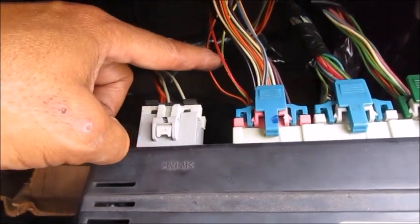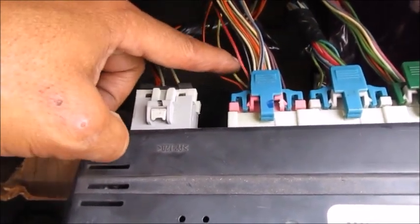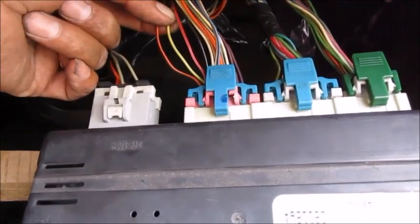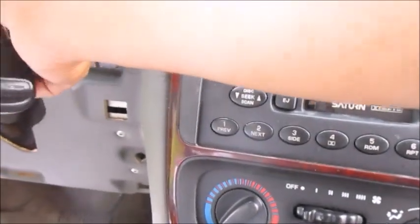From the ignition to the black, you get the ohms, and then after you get those ohms you match it from the black to the body control module. I stripped the black wire and cut the yellow wire with room — this is from the ignition, and this goes to the body control module. Got my ohm meter ready. Put the key in the run position.